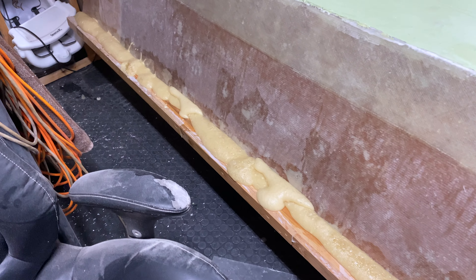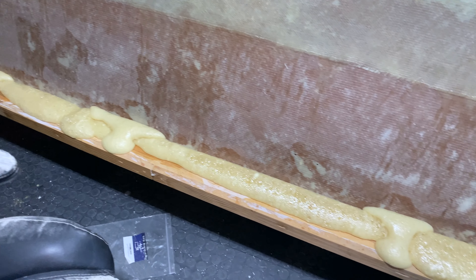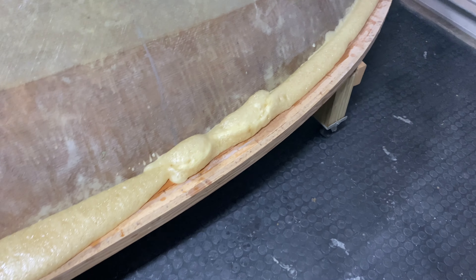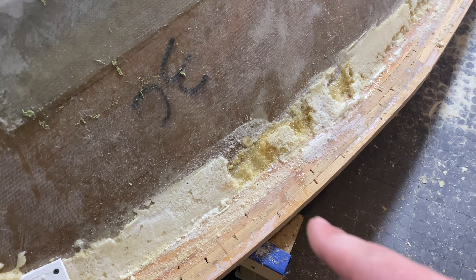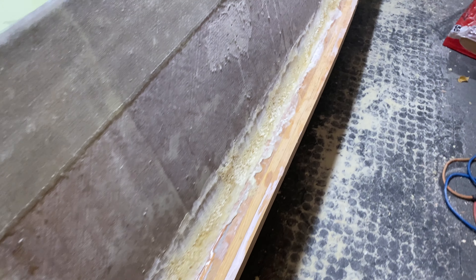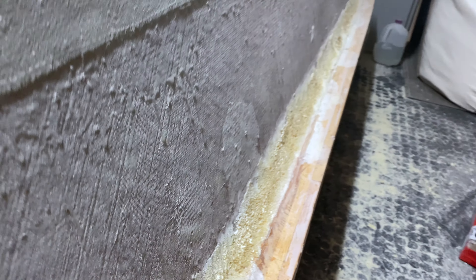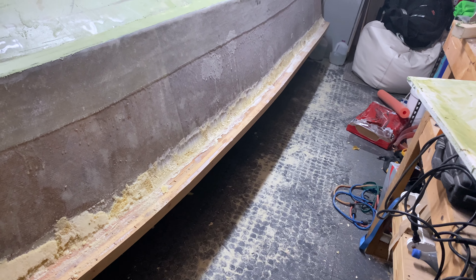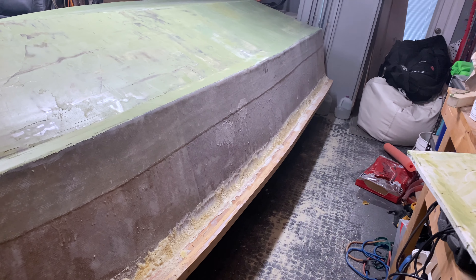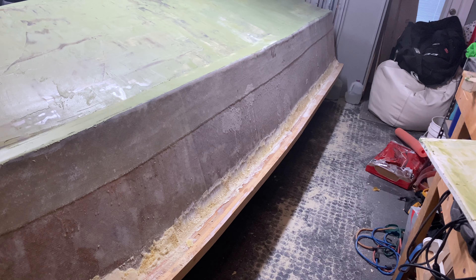I used two-part pour foam to fill in the gap all the way around the rub rail and spray rail. I wanted to get a little more flare on this side — I was using a board screwed against it trying to get a flat look, but it was pulling up, so I just poured the foam on the other side. Down here I've taken my grinder and pulled it along to make a nice little concave so I can wrap some sandpaper on a pipe and sand like this to get everything smooth, then lay glass out to the edge of the spray rails.